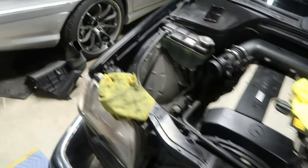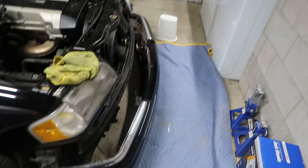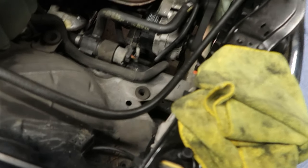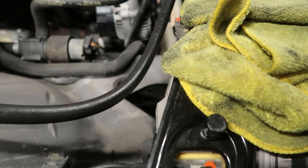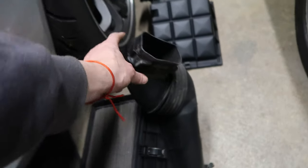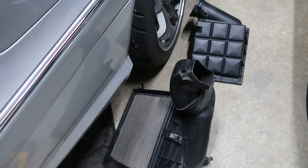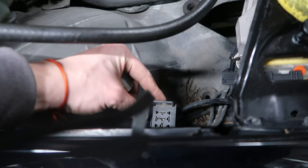The bumper came off. The fog light on this side is still attached, thankfully, but to get to the plug you'd need pretty small hands — mine couldn't really fit. The plug is right there; I'll get that off in a second. To get the air box out you first have to take off the top connecting piece — the classic Mercedes ram air intake setup into the intake box. There's also a relay setup that attaches to the side of it with a little screw, but to access that screw you have to remove the relay first.